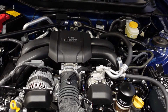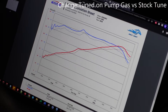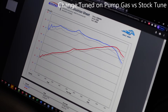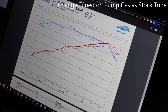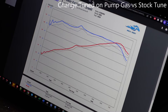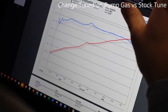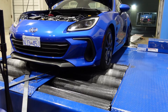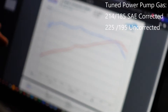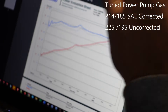So let's move on and start with tuning the car. Here we have the car tuned with the same configuration — unequal length headers, mid pipe and cat-back exhaust, everything else stock — tuned on pump gas. We've made some nice gains across the board, which is what I want to see with tuning. This is all SAE corrected, which is quite effective for naturally aspirated vehicles to normalize results as ambient temperatures change. We're seeing peak numbers of 214 horsepower SAE corrected, or around 225 uncorrected on this dyno.